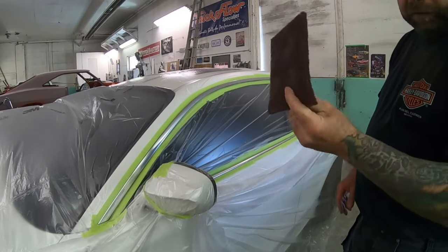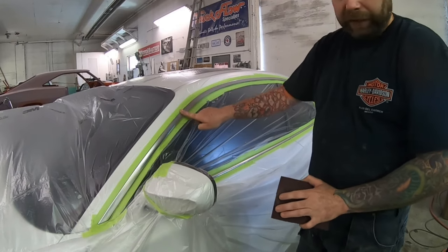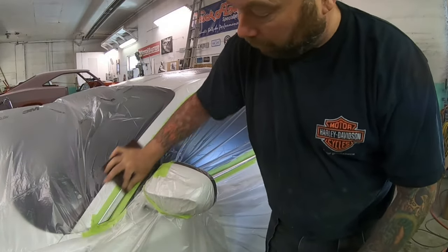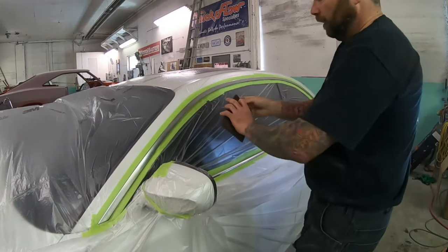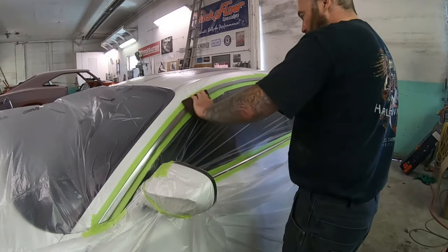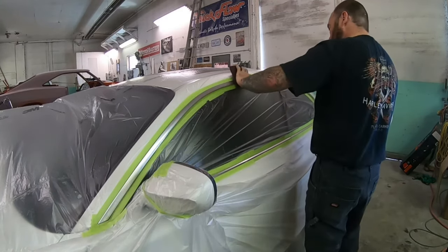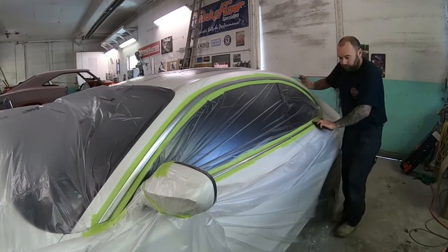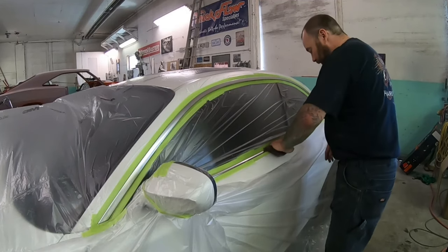So we're all masked up, and now this next step is very important. This is a 3M Scotch-Brite sanding pad — this stuff has to be sanded. If you just put paint right over that shiny stainless, it's just going to flake off. Any little thing that hits it, going to the car wash, using a pressure washer — you're going to blow all the paint off. It doesn't need a lot, it just needs that little bit of a tooth for the paint to adhere to, and the edges are the most important. If you need one of these, just go to your auto parts store — they'll sell you a single Scotch-Brite pad for like a dollar, so there's no excuse.